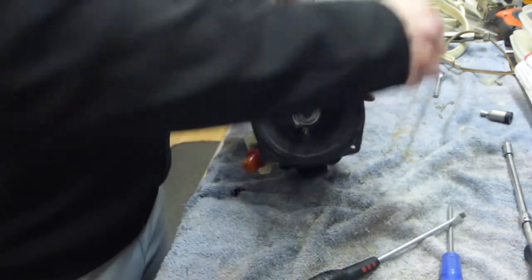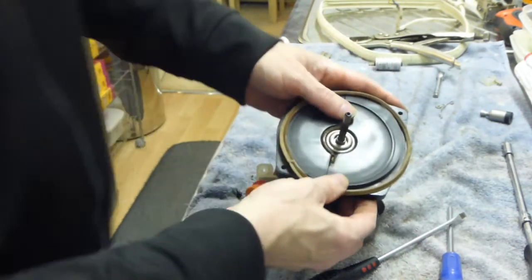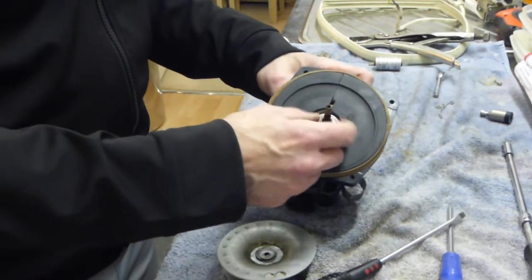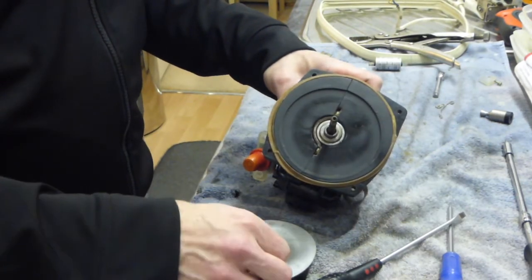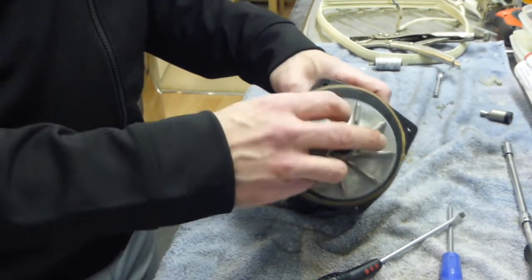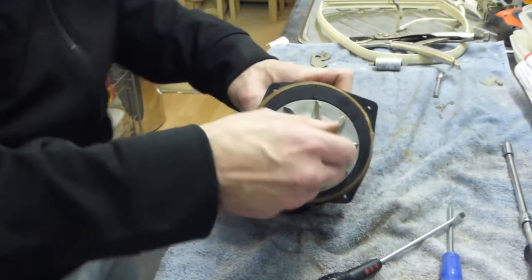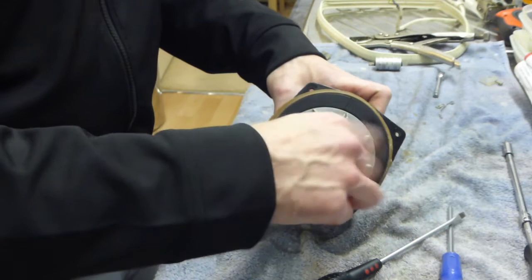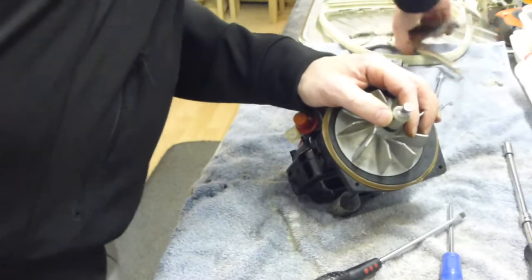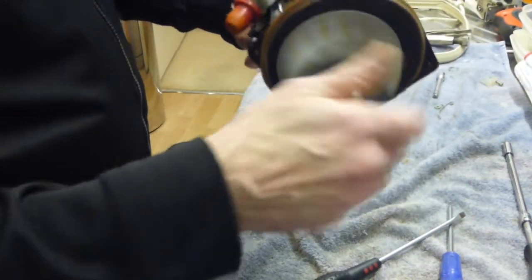So we're going to just now literally put the fan back on and the fan case seal. That goes around the outside. Where's the fan gone? There we go. So the fan, we want the bush on first, sorry, and then we want the spacer washer, the other spacer washer. Then the fan will push on, and then we'll put the pulley back on, and we tighten that in a reverse thread. Doesn't have to be really tight, but just tight enough. Where's my mole grips gone? There we go. So that's that.